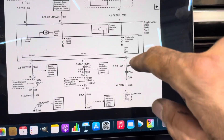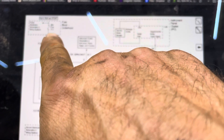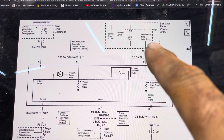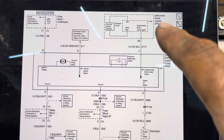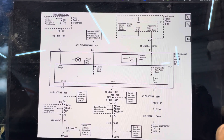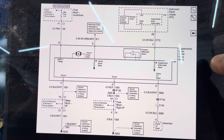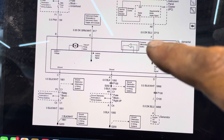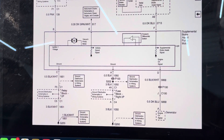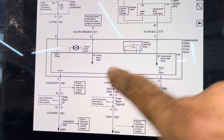This is the motor, and it shows that it goes from that 15-amp fuse — SBA, supplemental brake assist. It also goes up into the instrument cluster, which I believe might be the entire problem here, because I do have a battery drain when left off, and a brand-new battery will be dead in a week if nobody drives it. All of the wires are intact, all of the fuses are good and get power, but I'm only getting limited power down, which would be like either your logic or your 5-volt down to the motor itself.